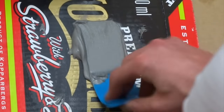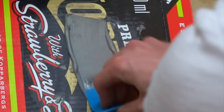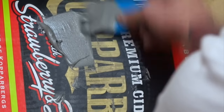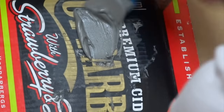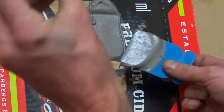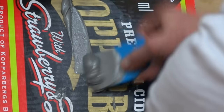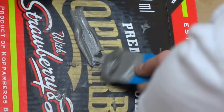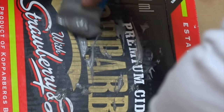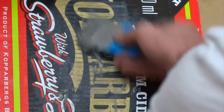Now it's time to mix up some filler. I'll give you a rundown on how to do that — I decided to go ahead and do it without the camera. However, I've mixed pretty much a hundred parts filler to one part hardener. I'm just scraping it all up, flattening it all out over and over again, getting rid of all the air bubbles, and making sure it's nicely evenly mixed throughout — for a good, solid mix of filler.